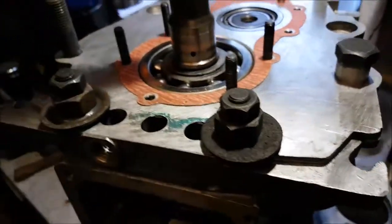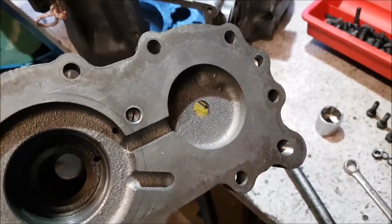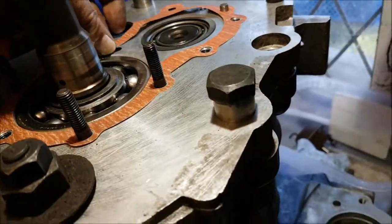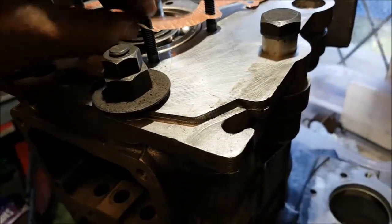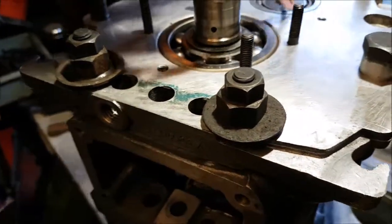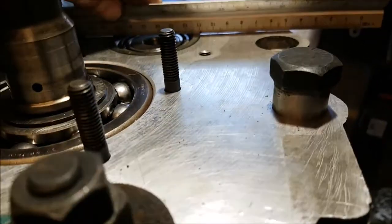So I'm wondering if there was a gasket underneath this before, or whether the gearbox just hadn't been built properly. On the back here you can see that's pretty flush there. There's no proudness for the shim — the shim effectively goes around this hole here where the lay shaft goes. What I could do is carefully remove the gasket. So the gasket's going to come off here. Right, there's the gasket. What I could actually do is take a flat edge and measure across there — you can see there's daylight underneath it, so there must have been a gasket on there before.